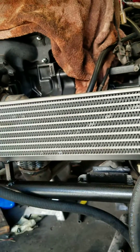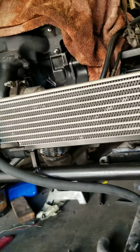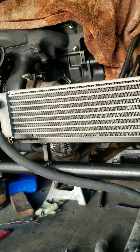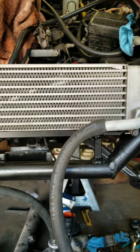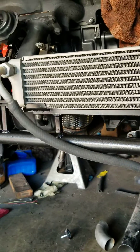This originated as an oil cooler from a Mercedes 300 SD turbo diesel, so it had probably about 32 years of oil and crud on the inside of it. I did bake this in the oven on self-clean — that is my favorite way of getting coolers clean. It works like a champ.